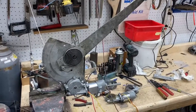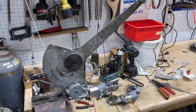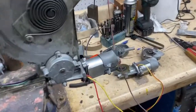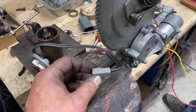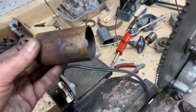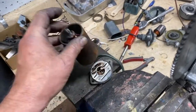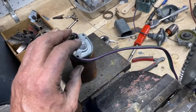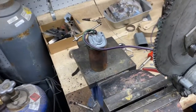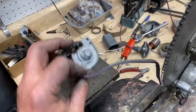What we have here is a 1967 Chrysler Imperial Regulator electric window motor. We actually got two of these motors, both of which we have completed now, or nearly completed — we do have to wire the original plug back in. The problem with these was that the original motors, which are 1967 technology, look pretty stout and good, but there was nothing we could do to get these original motors to operate free spinning at less than 6 to 8 amps, which is what they should be drawing when loaded. So we had to abandon the original motors.